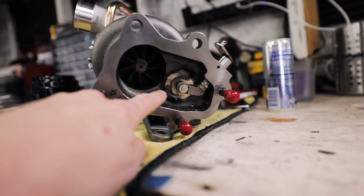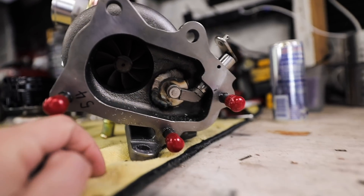To expand on boost creep a little bit more: once that internal wastegate hole gets overworked, that exhaust gas has to go somewhere. If you can't physically flow enough exhaust gas out of your internal wastegate, that gas spins up the turbine wheel a lot more and in turn spikes your boost. This can be a lot more frequent in colder weather as the air becomes more dense than in summertime, but it's still a very real issue. That's a pretty good reason why you'd want to go to an external wastegate — it helps regulate boost pressure and completely mitigate boost creep.